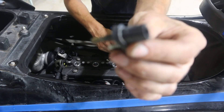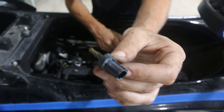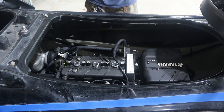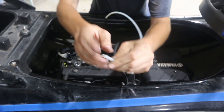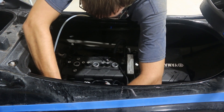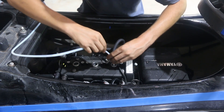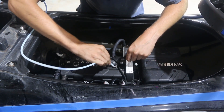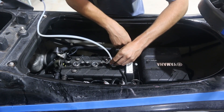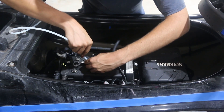This little sensor right here has a Phillips screw on the end — this is what we want to remove to put our oil extractor hose down in there. To get your hose down in there you're probably gonna need an angle cut on the end. Take the end of the oil extractor hose, dip it right down in each cylinder, and suck every bit of water out that you can to minimize what you have to blow out.